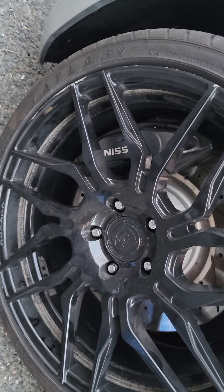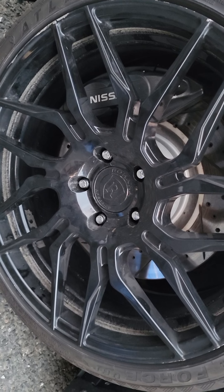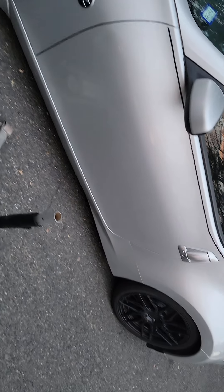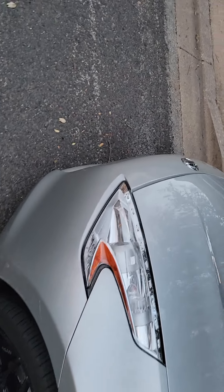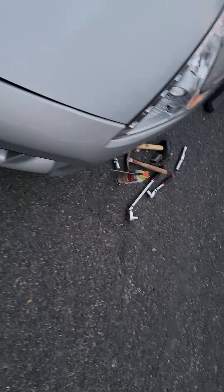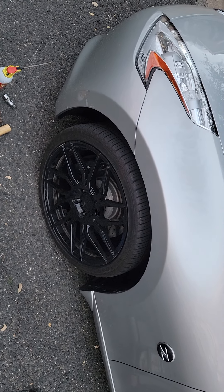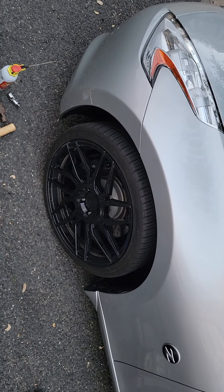I got everything back on. This may be a two-person job if you want to go faster, so one person can hold down the brakes — that way you don't have to lower the car to torque down your bolts. Make sure you torque down all your lug nuts. I set mine to 74 ft-lbs; I think between 70 and 80 is fine. So it's about a two-person job and maybe about 45 minutes and you will have your new hub on. They usually recommend doing it in twos since they probably go out about the same time, but I didn't have the money for that. Thanks again and I will see you on the brake line video.